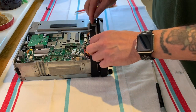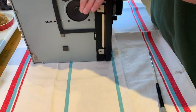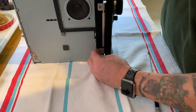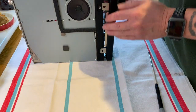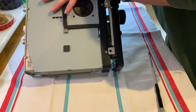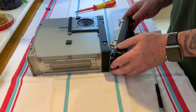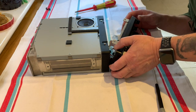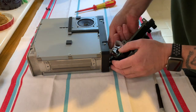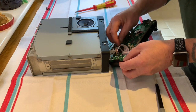You've got to be careful here. There's a couple of plastic leaves that you lift up — they're not screwed down or anything, but they can be easily broken, so just a little pressure to lift them up. There's also a couple of Velcro fasteners that hold the power cables in, and the ribbon cables also tend to be a little bit fiddly, so try not to twist or break those.